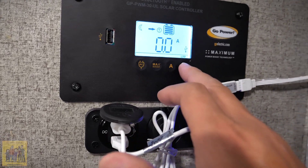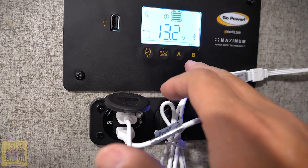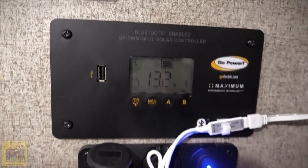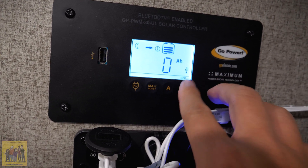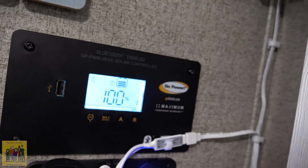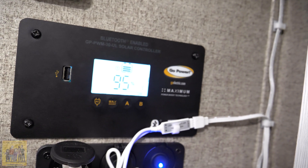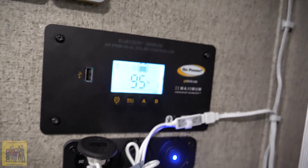There's no reason this should be reading 100%, so I'm going to unplug it from the AC outside and see if the voltage drops. It's charged to 13.2 volts and it's already actually dropped to 95%. So it's basically charged to about 80% — that's what that means.